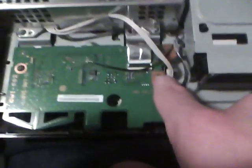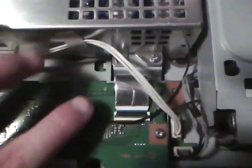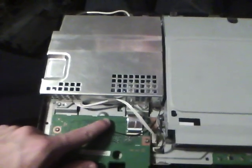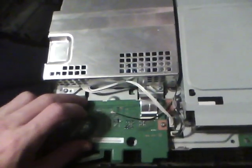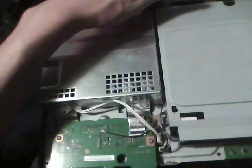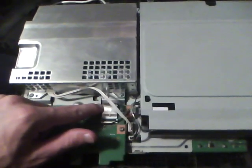What you're going to want to do is unscrew these two screws right here and pick this up. Be careful because this thing's still connected. Make sure that both sides of that are connected — actually connected — because if both sides are not connected, this thing will not be receiving power from the motherboard down below, and therefore your antenna will not be receiving any power at all. Make sure both sides are connected to fix the internet problems.